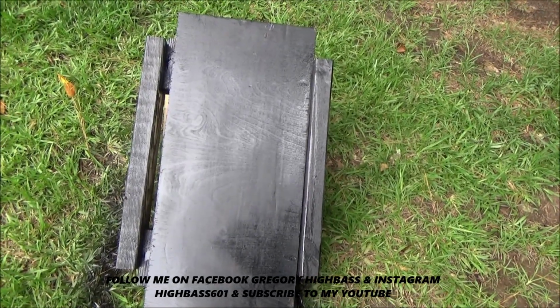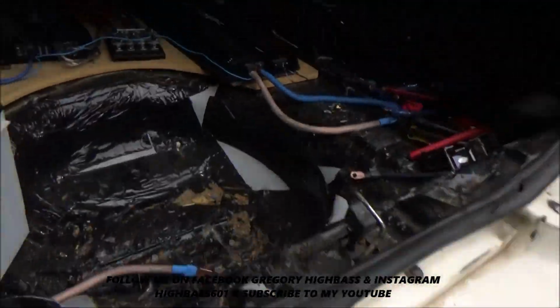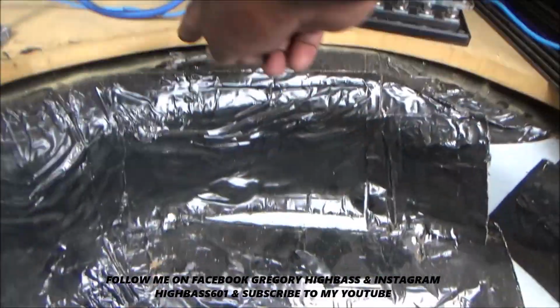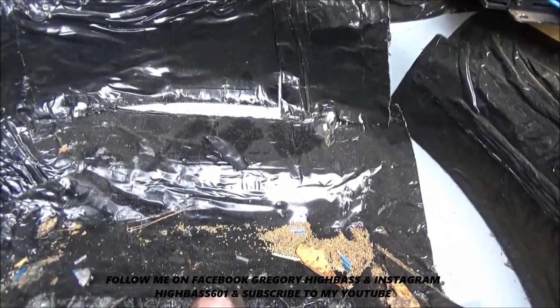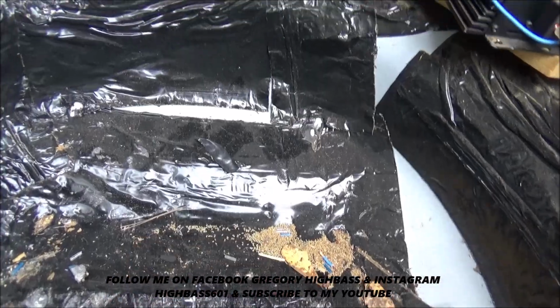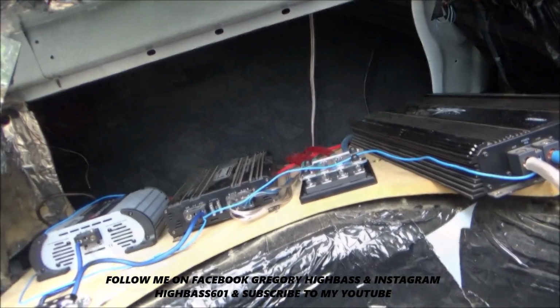Plus, that board is gonna be drilled down inside the car 4 ways. Here, here, here, and here. Plus it'll have a support brace in the middle. So now, while that dries, I'm gonna run out my power wire.